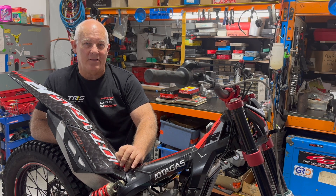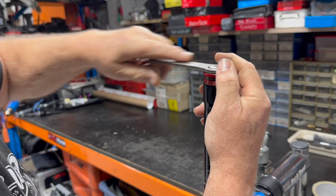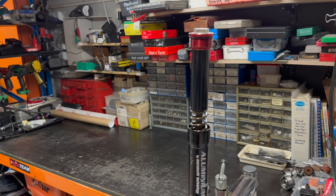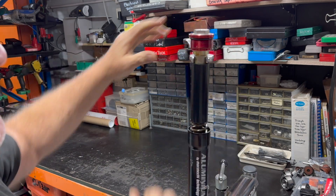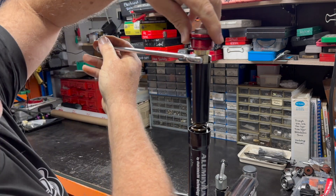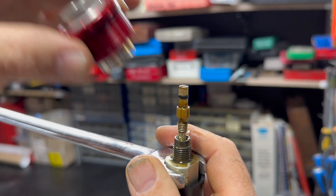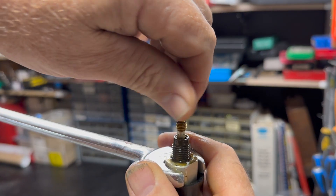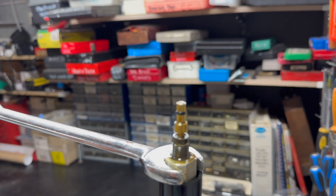We'll dig deeper into it and have a chat about the way this works and the way to fix it. We're going to push through some of this early stuff a bit quickly because it was covered in part one. Using either a special tool, a pin spanner, circlip pliers, whatever you like — get that cap off, slide the top down, slide the preload spacer down to give you access underneath. It'll clip underneath that piece there. Get a spanner in — it'll be held in place — 22mm ring at the top. Just break that and wind that cap off. Be careful because you've got the brass rebound rod underneath which is a little bit fragile, so just be careful as you pull it off, nice and straight.